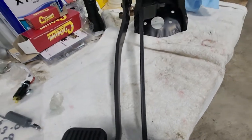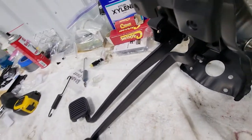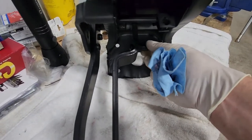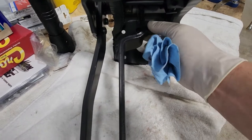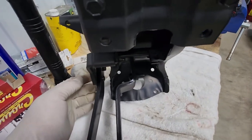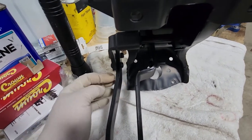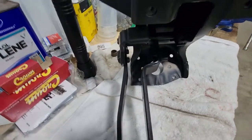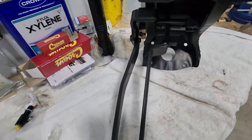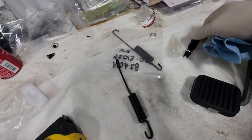Pads are on. As you can see we're fully assembled, everything's tight. This is basically the pedal assembly — it does come apart very simply. This is where the shaft to your brake booster would attach. I am not doing a mechanical clutch — I'm going to be putting in a master cylinder, so I'll be drilling somewhere along the line on this shaft to mount a pin to get to the plunger for my slave cylinder. That'll happen once I get it mounted in the Jeep tub. I'm going to check out what's the deal with these springs as well as the brake light switch.